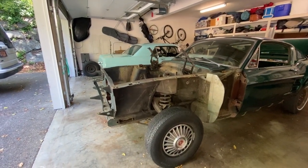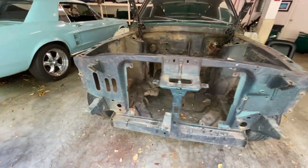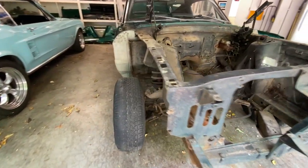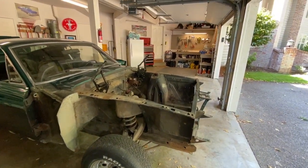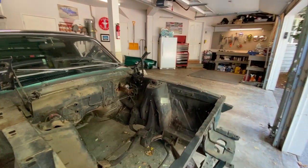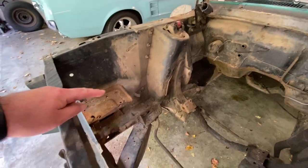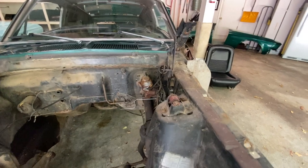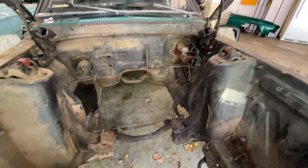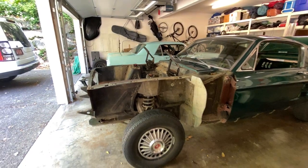As you can see, I've got all the fenders off, all the grill stuff off the front. There was a bunch of trim up here that had to go. I've got both fenders completely off, and now I can get a real good idea of getting access to all these other pieces that still need to come off — the battery tray, some of these hoses, the back of the heater, master cylinder, a bunch of the steering linkage — that's all got to come out. The column I still don't have out yet, but it's starting to look like a bunch of parts rather than a car now.